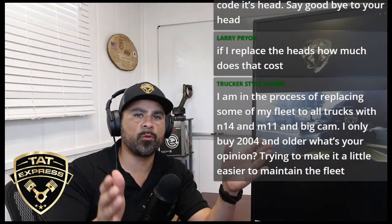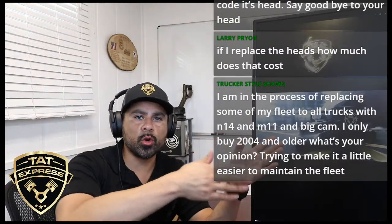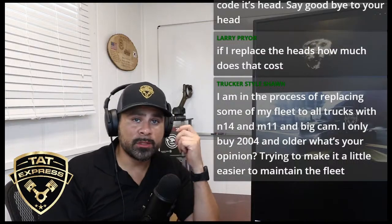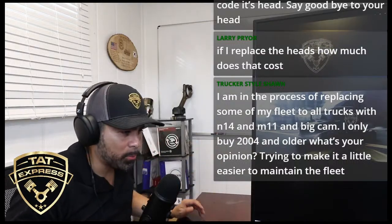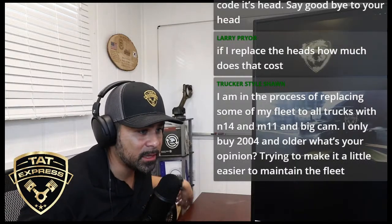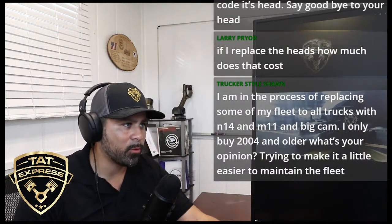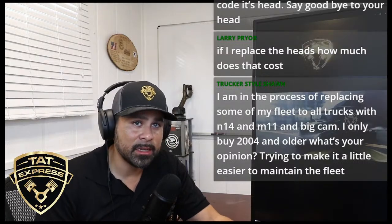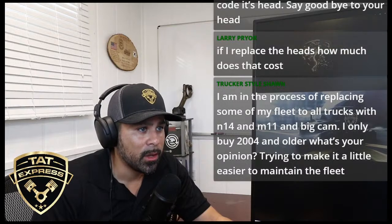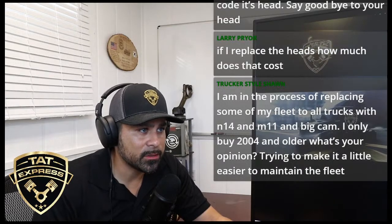So for example, if we move from 1 to 2 or 1 to 3 and we let you run, and the code moves, then that's an indication that we're on point. If the code moves, that shows it's an injector. If the code doesn't move, then that's going to be a mechanical fault. So thank you for sharing that.